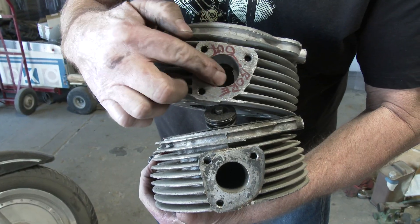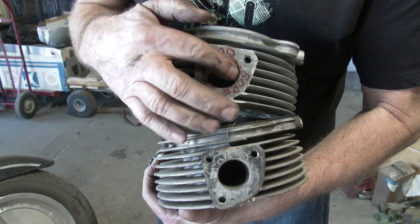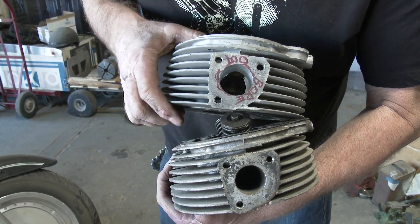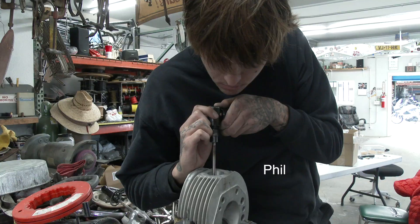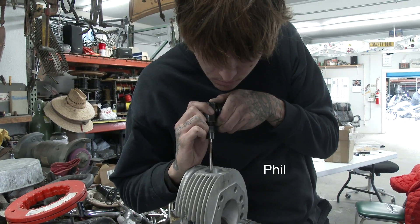So this is about 30 millimeter bore - that's a stock ambassador bore. This one has been cut out, so this is about 33mm. That's the same bore as El Dorado. After we bore these, we've got to go in with a Dremel at the end.